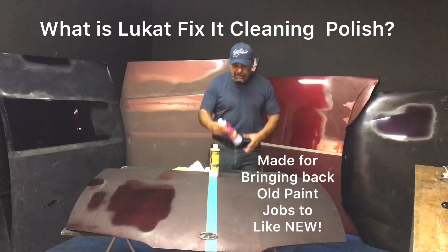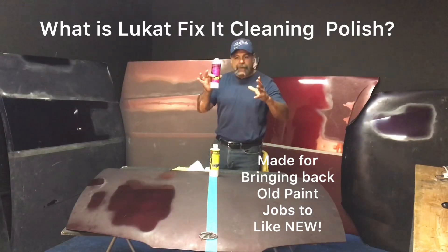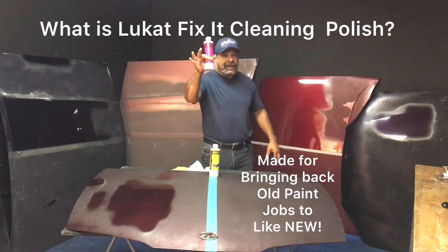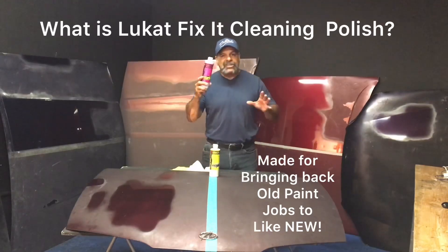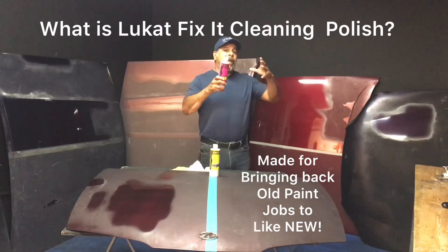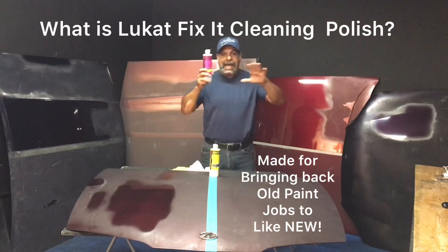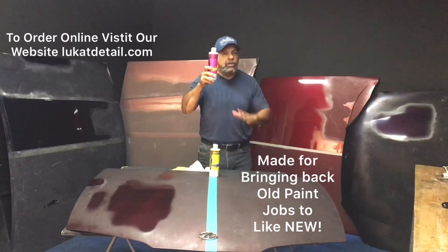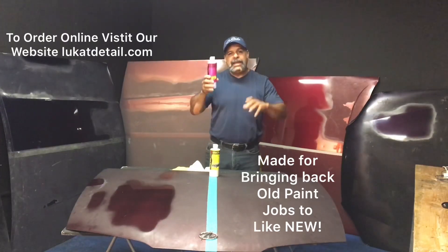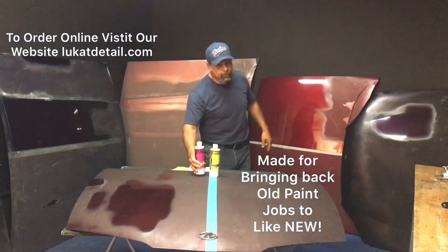The other product here is a sealer. This stuff will seal your paint, give it a beautiful, durable, protective shell. If you have a semi good-looking paint job, you can use this with a DA polisher and a foam polishing pad and polish off all kinds of stuff — it'll look perfect so you can wax. Usually you have to wax after you use this. Even though it is a wax and does have shine, it's designed for polishing lighter contaminants. It's really good stuff.